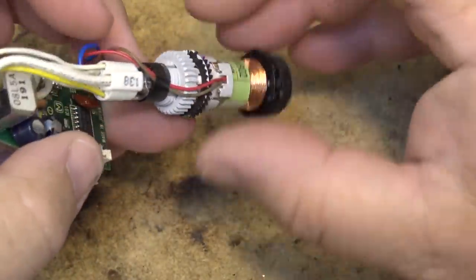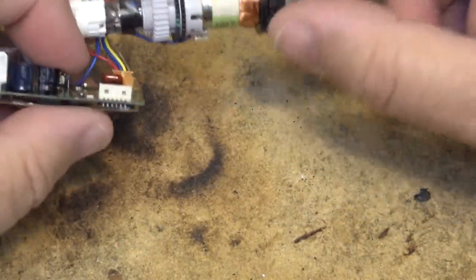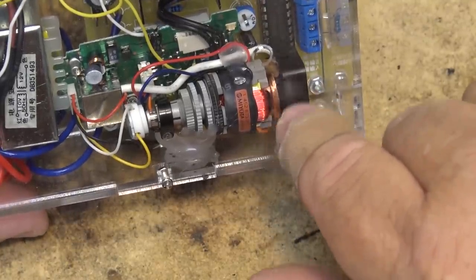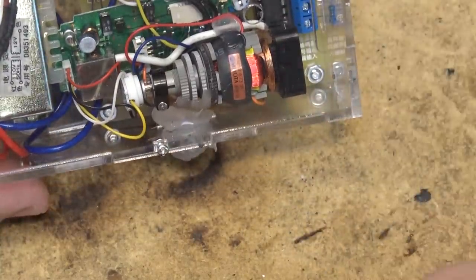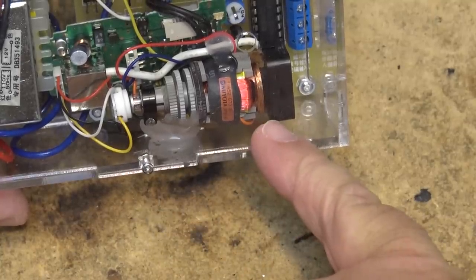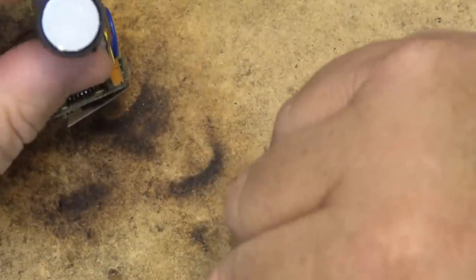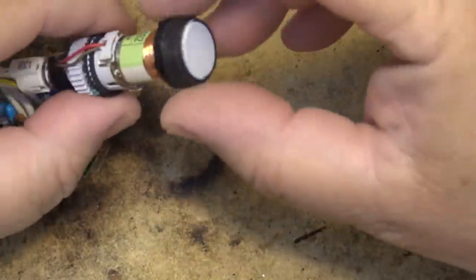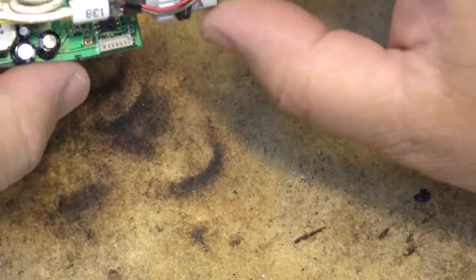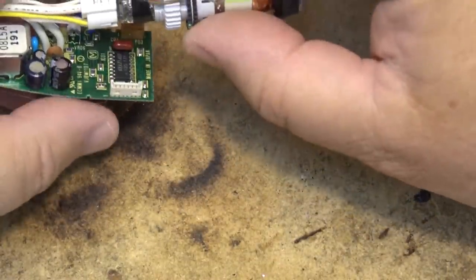On this tube there's no second anode connector at the front — it's all done through the socket. The high voltage from the flyback transformer goes into a shielded pin to deliver high voltage into the tube itself, and it actually travels up the inside of the CRT to the second anode. Whereas on this other design, the flyback transformer has a separate high voltage wire connected to a connector on the edge of the tube to deliver high voltage directly to the front — more like a conventional CRT.